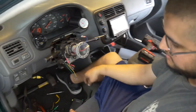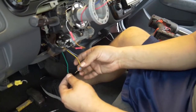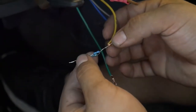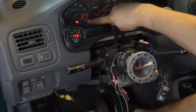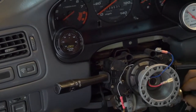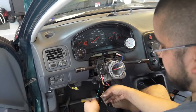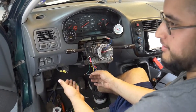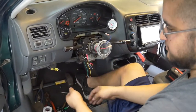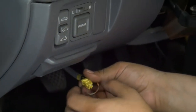Now let me show you how I took care of the SRS airbag situation. Obviously we're getting rid of the factory airbag, so the SRS light is going to be on in the gauge cluster. These are the two wires for the airbag — green and yellow. You need a 2-ohm resistor, but we didn't have one, so my buddy made a 2-ohm resistor out of two separate resistors. Without the resistor the SRS light is going to be on. I've got the 2-ohm resistor in place — what it does is replicate the resistance of the factory airbag, basically fooling the computer into thinking the airbag is still there. Once the resistor is in place, there's a service plug that plugs into the fuse box under the dash — it's on the top right corner of the fuse block and is really easy to get to.